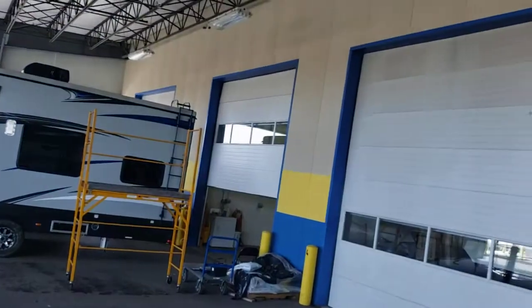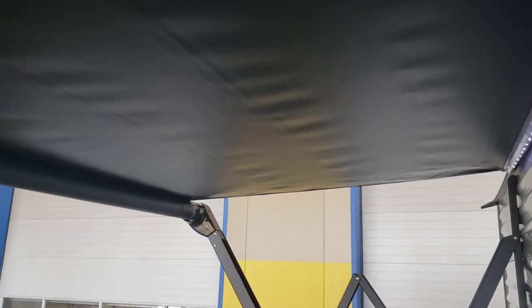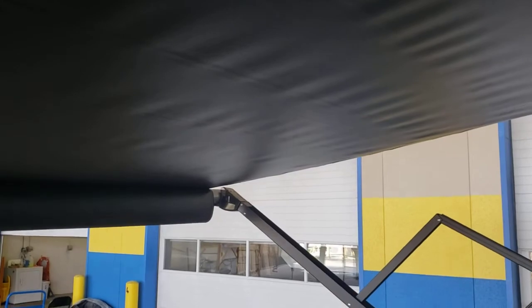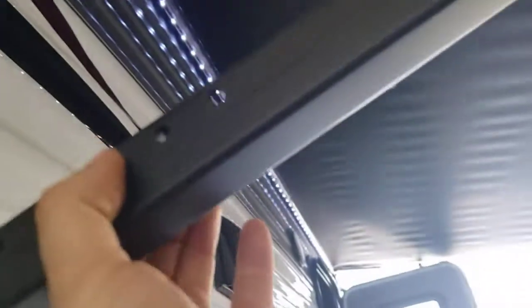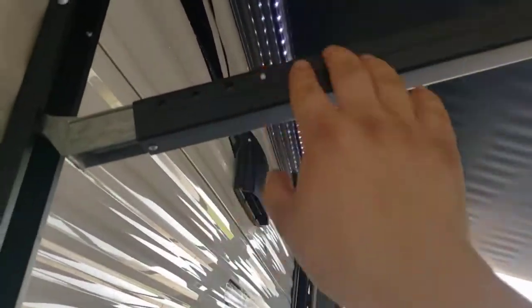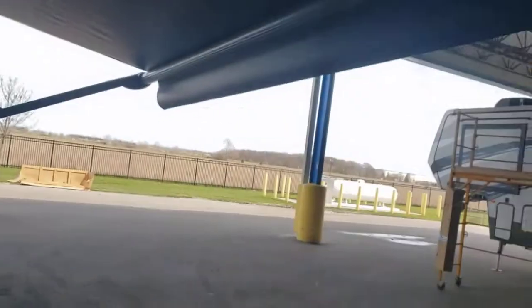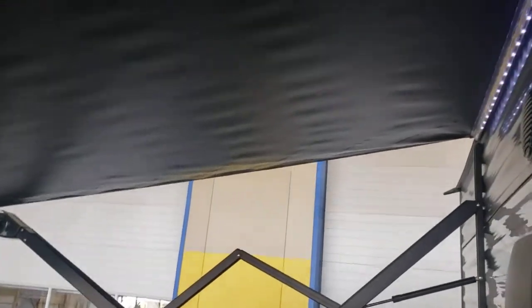Ready to go on the inside. Got your controls for your awning here. Your awning does not stop automatically when it's all the way out — when you see the bare tube, that's all the way out. They are adjustable for pitch using the little metal detents on each side: pinch them closed and pull it down to adjust. You can have one end pitch down so if it's raining, water comes off the side. If there's a big storm or gusts of wind, roll your awning in — you don't want the wind to break an awning arm or tear the fabric.